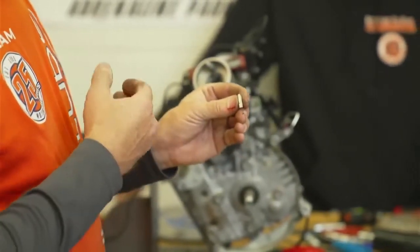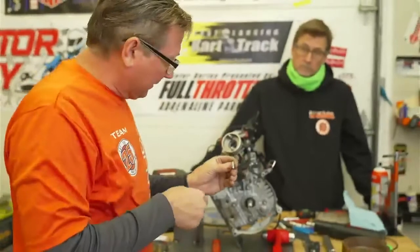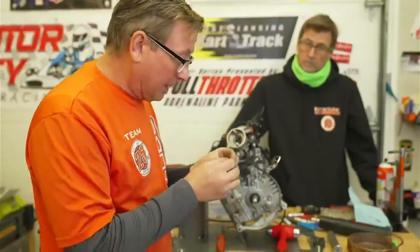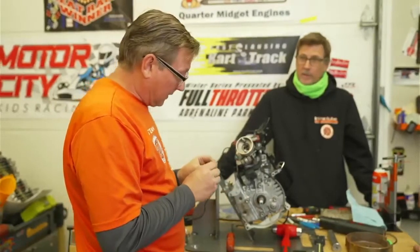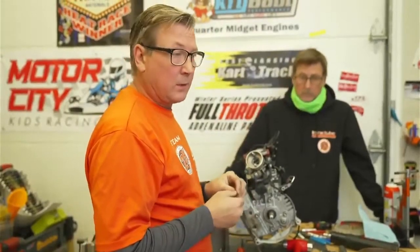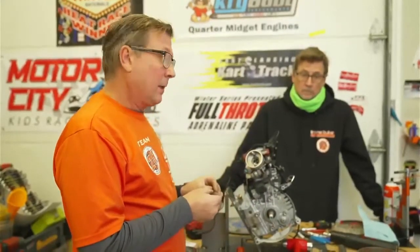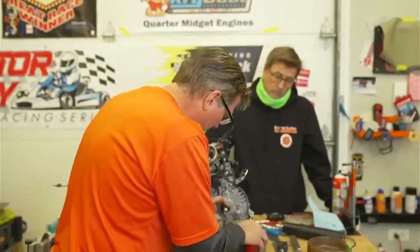If these governing bodies would just leave it at 25 the way it comes, it would be much easier to look at the key and go, okay, this key's never been cut. I got one better. How about open timing? You can run whatever timing you want. Then we'd never have to check timing again. Yeah, and what John's saying is on an open timing rule, what that means is run any timing you want. Okay, we're all going to figure out that, hey, these engines like 30 degrees timing, and all of them will be 30 degrees. And then we don't ever have to do this again because timing isn't an issue. And that would be called open, or non-tech.